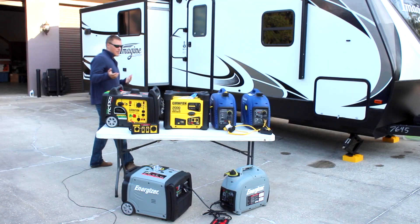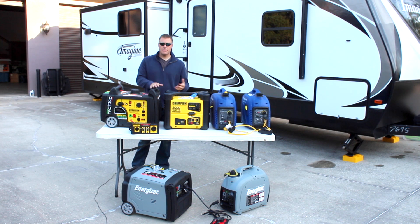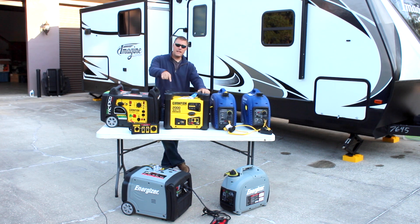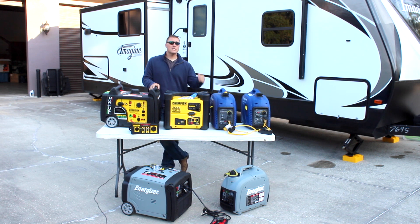Why is one better than the other? The 50 or 30 amp receptacle is super useful for those of us in travel trailers and RVs, because if you're only given a 20 amp receptacle you can only run so much at one time. Our AC pulls anywhere from 14 to 18 amps depending on the outside temperature, so you're almost maxing out your generator at that point. With a 30 amp receptacle you can run the AC and the microwave at the same time. Jump up to 50 amp and you can run almost everything in the travel trailer simultaneously — the exception being running the AC, microwave, hot water heater, and electric fireplace all at once, which would put us just over 50 amps, but that's not a realistic scenario.